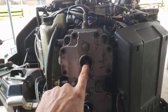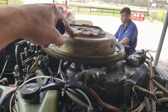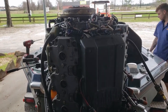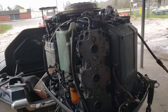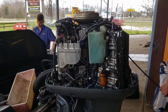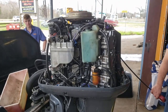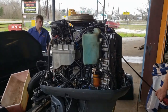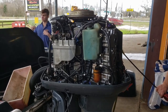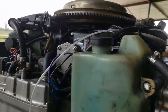We've started to remove this head, but we know this cylinder is burned, so we only removed these bolts. We went through the spark plug hole because the motor was stuck. We tapped on the piston with an extension carefully while applying some pressure up here, and we got the engine to unstick pretty easily — it rolled over. We blew any aluminum debris out with an air blower. Now, this OX66 doesn't run a lot of compression. After it was rebuilt it was about 115. One of its failures I believe was the engine control module and the stator.